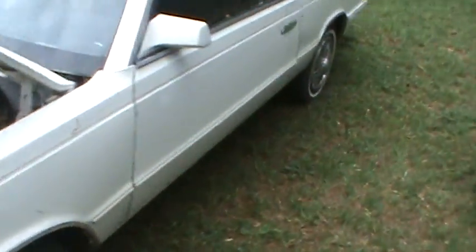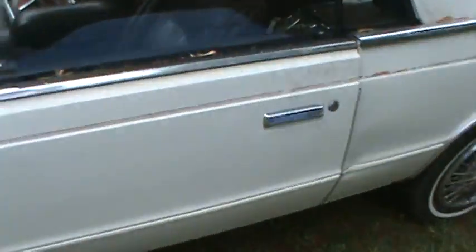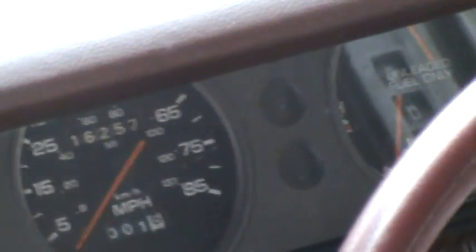So the first thing I did was I pulled the codes off the power loss light, which in these is right, you can see it or not. Where is it? Well, it lights up right there. So on these era cars, these Chryslers, to pull the codes out of them, to get it to blink the codes, you just turn the key on and off 3 times in rapid succession within, I think it's 10 seconds, something like that, 5 seconds.